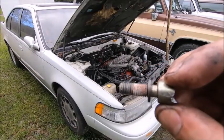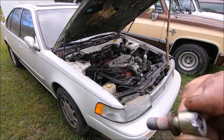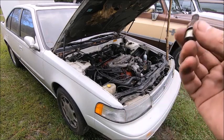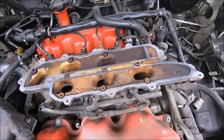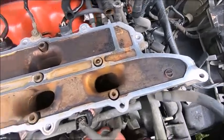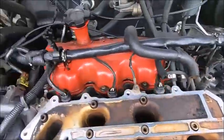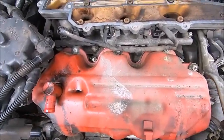That's the corrosion you're dealing with — these bolts have probably never been out and it's a mess. We got the bolts out and we're definitely going to get new ones. We got them all loose, so hopefully we can pull that plenum up now. The upper plenum is off. Wow, is that dirty — I'm sure it's never been cleaned. We'll take off the lower plenum and all this ancillary stuff so we can get down to the heads and valve covers.